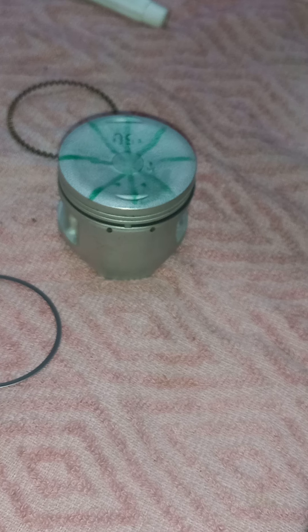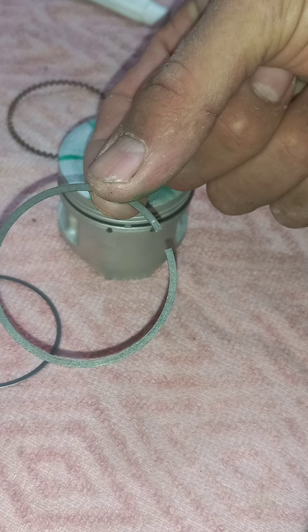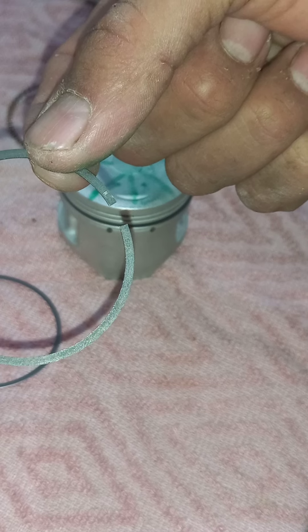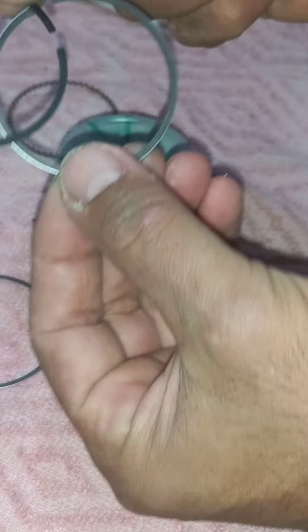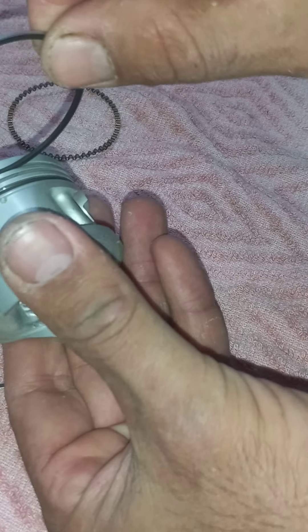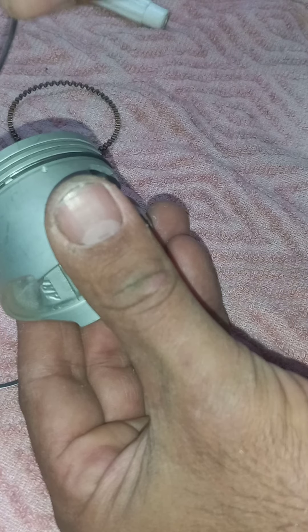Note: be sure to check the manufacturer's marks or numbers stamped on the rings are on the top side of the rings. I noticed only this one has a stamp. Sometimes there is no mark, laser mark — there is a stamped point on the ring. You can see it sometimes here or here. Because this has a mark and this has no mark, I want to check if they are similar in size. Enter here clearly — don't do it like this, you will break it.